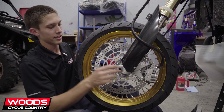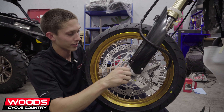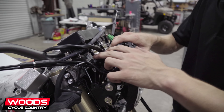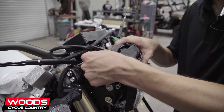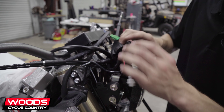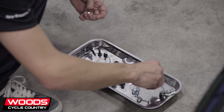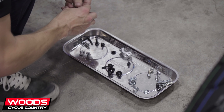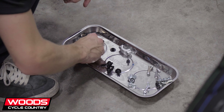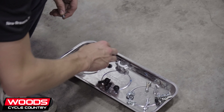You don't want to tighten this down until you take it off the stand, because there's a certain order you want to tighten these axles or else it could throw the wheel off a little bit. Checking to make sure the speedometer cable is tight and everything looks plugged in, because you're pretty much going to bunch this up and put the light over the light housing. The hardware is pretty specific to where it goes. If you get a bike from a dealership and something looks wrong, don't be afraid to take it back — some technicians don't have a lot of experience putting these together.